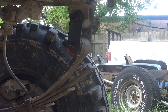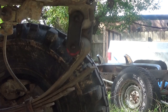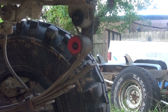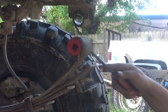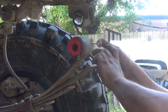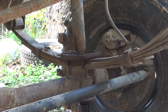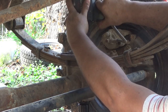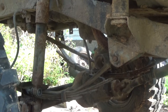To take these loose you just need a 17mm. Just like the other side, the trick is to take the weight off of it so it's easy to come apart. At this point I have all the bushings knocked out. I'm going to take the U-bolts loose, flip the spring around, and then continue as if I never had to do this, because this is not part of the procedure. I only did this because my springs were mounted backwards. Alright, back where we left off.